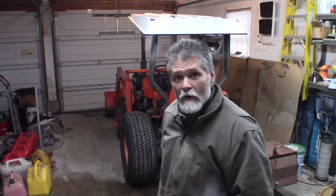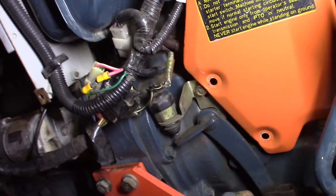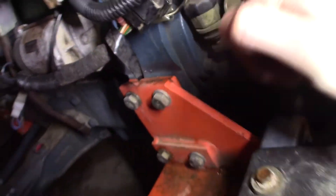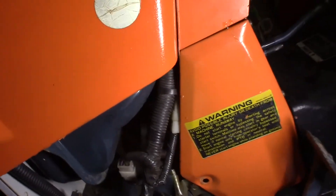So there's one panel on here — I pulled that off — and I'll show you how I figured out what was causing this problem, why it wouldn't crank. I've got the panel off of this side; it bolts down to the front of the platform step. Right here you can see the neutral safety switch, which when you push the clutch in, it pushes up on that like that. So it's not the fact that it's not reaching — it's definitely doing that. I don't think it's worn. I don't even know if it's adjustable. But you've got two wires going to it, one from each side.